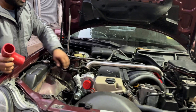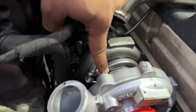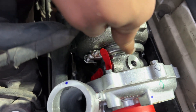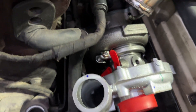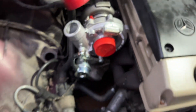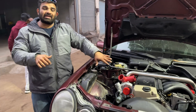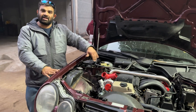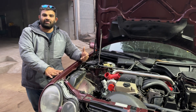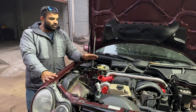These little tabs take oil in and out. It has a total of four tabs — two are for water and two are for oil. These Garrett turbos have the provision to be cooled by both water and oil. Had this vehicle had an EGR cooler, we could have routed the EGR cooler pipes into the water inlet and outlet as well. But since it doesn't have an EGR, we'll only be running the oil cooler pipes; the other ones will be plugged with a bung.